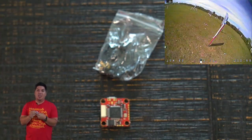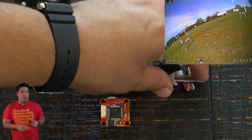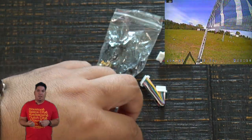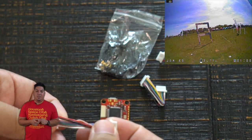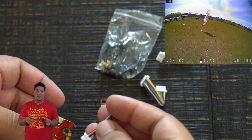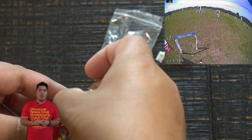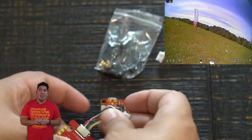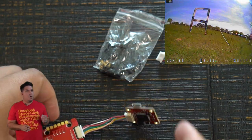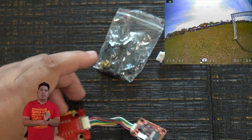Be very, very careful when you go to wire this thing up and make sure you have the right harness for the right ESC. That goes for any ESC on the market — even if you buy one that comes with a harness, double check those connections. Sometimes the quality control on those is not the best, and you're going to have a really bad day if you plug it up for the first time and it toasts itself. So always double check that.